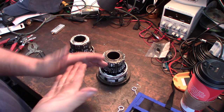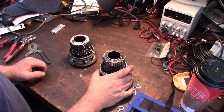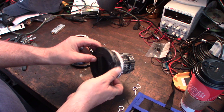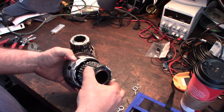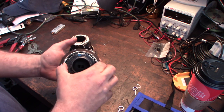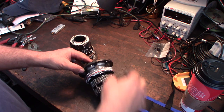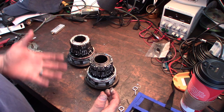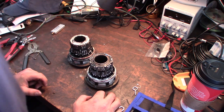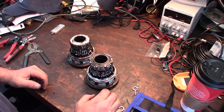It's because my truck has the coil front spring versus the old leaf spring, so they were different when they converted over to coil spring. They say this is a non-serviceable part, but let's see what I can do here. I know there's a snap ring here. What I really want to do is take this whole thing apart, soak it in some solvent and get all the grease off. I know the diaphragms work and engage when I apply vacuum to them. That's not really a big issue. I know they work, but they just lock on their own.